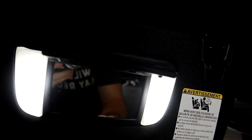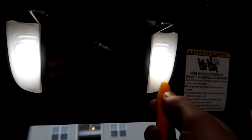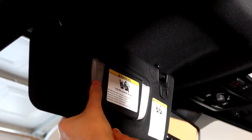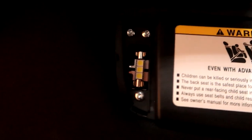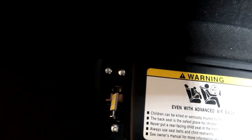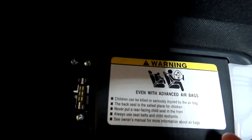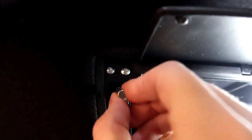The visors are really easy to replace. Take your pry tool, go on the bottom corner here, and it will pop the cover right off. Just get underneath this bottom ledge and literally pop it with your pry tool — it pulls right out and you can access the LED right behind it. To pull these out it's very simple — pry it out and take your fingers to pull it out. Slide the new one in and pop it into place. It didn't turn on at first, so pull it back out, flip it 180, put it back in — and it turns on.